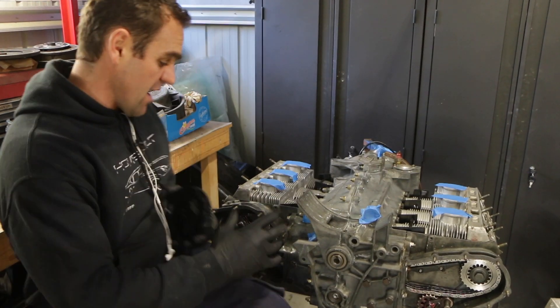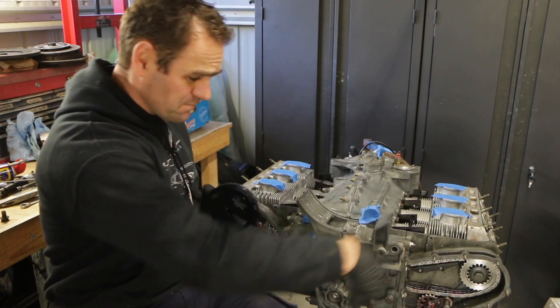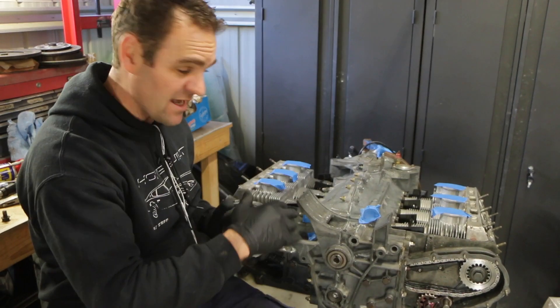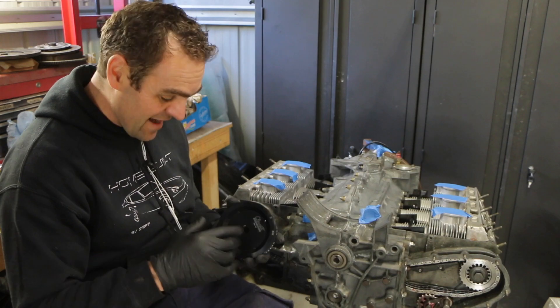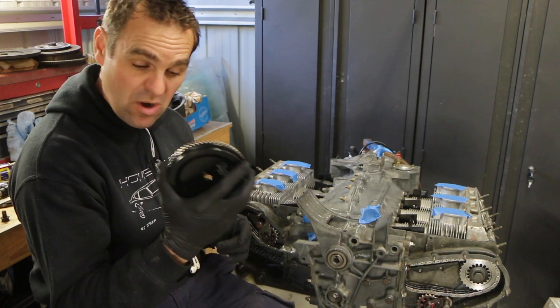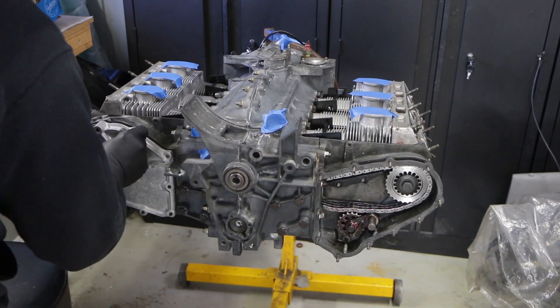I've been waiting to button up as much of the engine as I can so I'm not flicking magnesium around the place while machining this out. So I'm going to put covers on the chains temporarily, cover everything up, mask everything individually — all the holes — and then mask over the whole thing again, and then start machining out this little clearance and fitting my balancer.